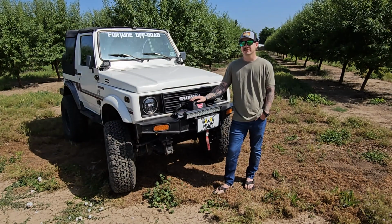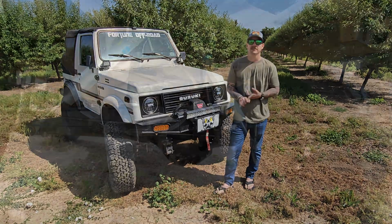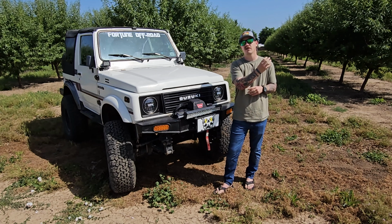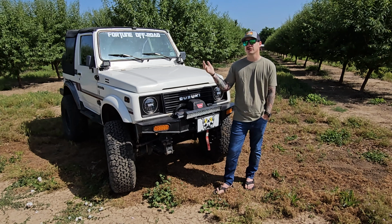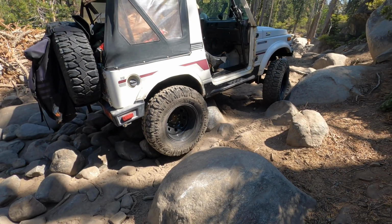The axle housing itself has had a lot of modifications. We've got the diff armor on the face of it, a truss over the back of it, and then skids along the whole bottom of it that are about, I think, 3/16 thick, that just make it so we can skid over all those obstacles when we're dragging those axles.